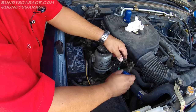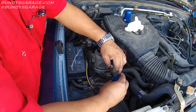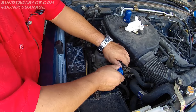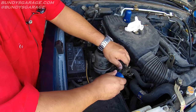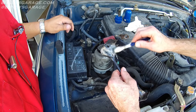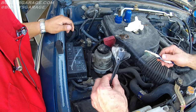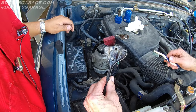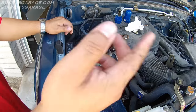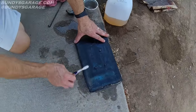Also, if you have a car with a stereo that has a security code, when you remove the battery you're going to have to reset that stereo for it to work again. So make sure you have that code on hand. I have Budget Bob with me — we figured if you pull off this bracket you don't want to put a dirty bracket right back on the battery and continue to put more acid back on. So you're going to do the job right: clean everything around it, do a thorough job. If it's really bad you can spray paint it. He's taking the tray out and you can see corrosion on it as well.